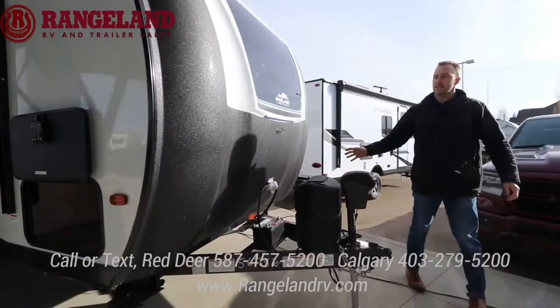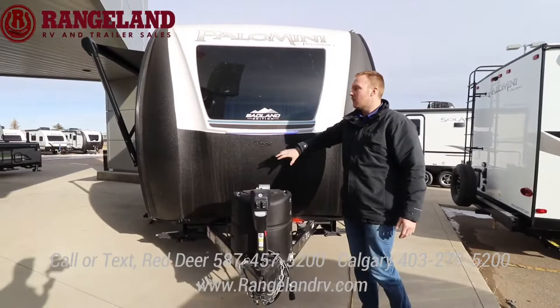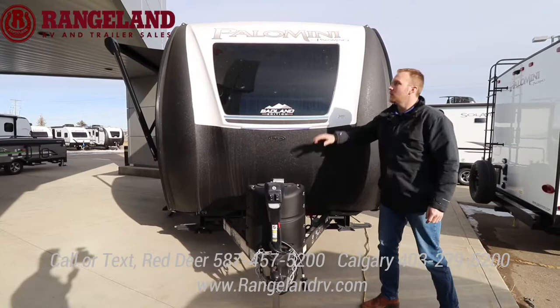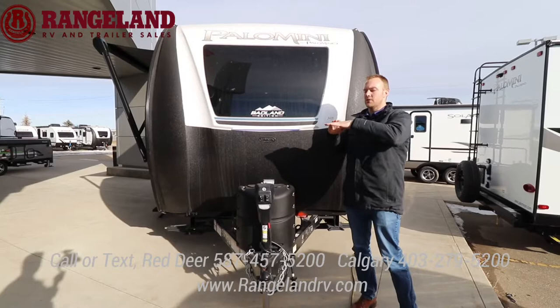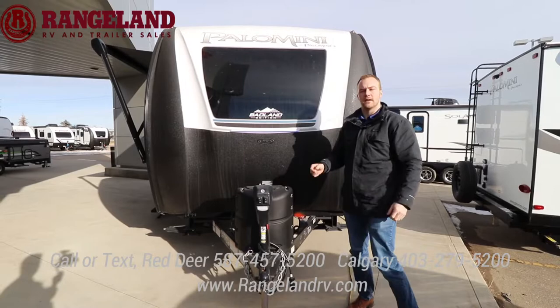Check out this massive full-length fiberglass front molded cap. From the manufacturer it comes with Line-X or RockGuard straight from the factory, so rock chips and debris are protected. A lot of other brands give you a three-quarter cap with checker plate going down — this is a full-length fiberglass cap. Where the seals connect to the roof, instead of a piece of fiberglass folded down that can stress and break away, this is molded, fits nice and snug. You put your seal on top, and over time it doesn't want to pull away — so there's much less chance of water leaks or cracks, and you can pack more insulation in there too.